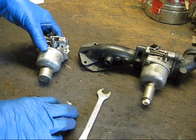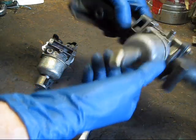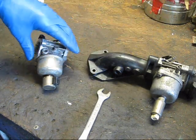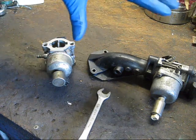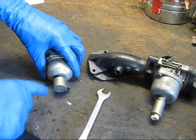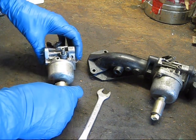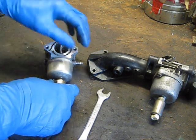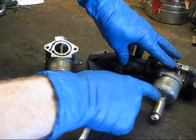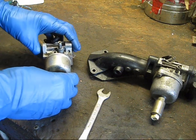On the bench here I have two carburetors. This one over here is a Walbro LMT, and over here we have a standard Nikki carburetor. Both of them have backfire solenoids on them. These are some of the most common carburetors you're going to come across when working on small engines. They were both used on the Briggs & Stratton Intec series. The backfire solenoids are these little devices on the bottom of the carburetors, and they do come in different shapes, sizes, and configurations, but they all function basically the same. The Walbro LMT has the shorter one, whereas the Nikki has a longer, skinnier one, but they both serve the same purpose.